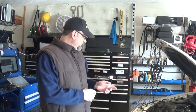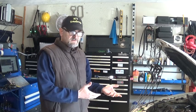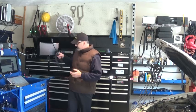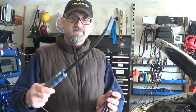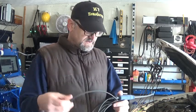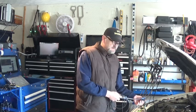Hello guys, I'm doing a little project today. I want to show you my ways of getting a secondary ignition waveform. With coil-on-plug engines it's getting more and more difficult to get a secondary ignition waveform. One of my favorite tools — using my scope — is a Pico coil-on-plug adapter. This is just a single probe; you hook up your lead to a scope and simply place the probe on top of the coil and you'll get your waveform.